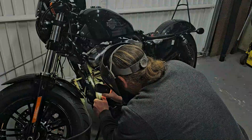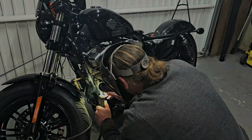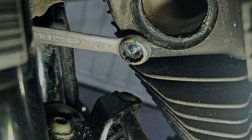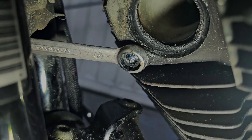For the next one we're going to put a dropper weld on a nut placed over the broken stud, and hopefully the heat will help penetrate and allow extraction. If it comes out in one — spot on. If not, we'll have to drill that one as well. So let's go ahead and weld that stud. We've just welded it now so hopefully with a bit of luck we should be able to extract it.